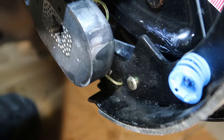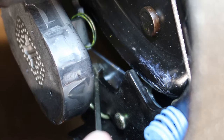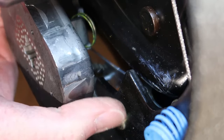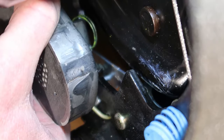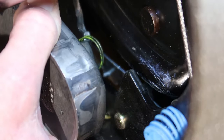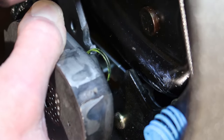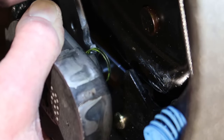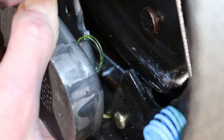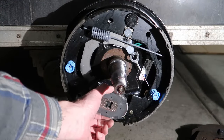We'll move the camera into a better position. Here's the arm right here and there's the star wheel. We apply the brakes — the magnet sucks itself into the drum and moves like so as the wheel is rotating. You can see that arm start to move out just a little bit, and it clicked. That means it engaged itself on the next higher tooth. When we let off the brakes, it rotates that star wheel. Here's another shot of how that works.